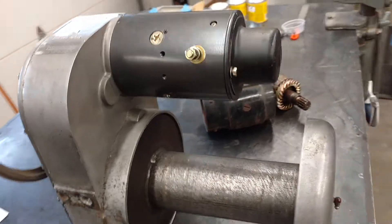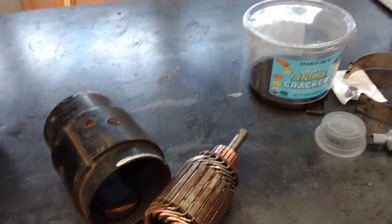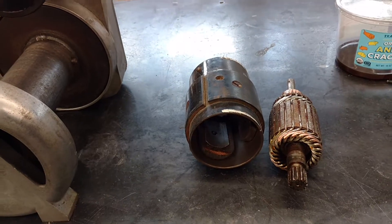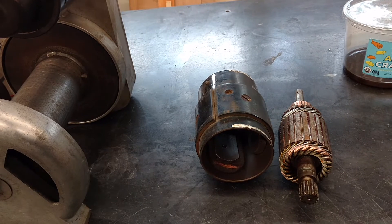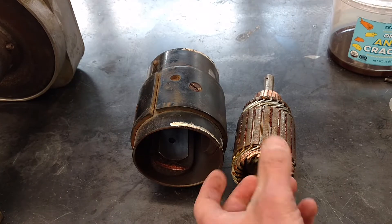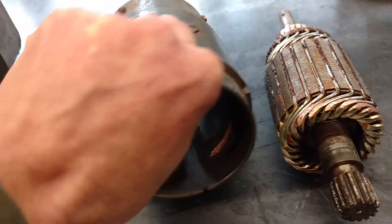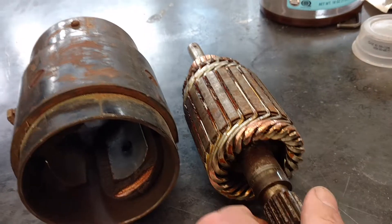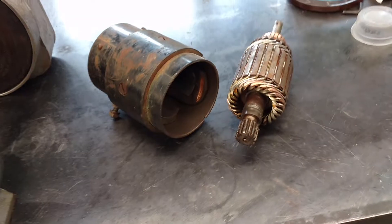Nice thing about it is it's only a couple hundred bucks — maybe just under — so it's better than paying 350 or whatever for a motor that you might not know will fit. Another thing about motors: here's the old one. You can't run these things backwards, it's just not good. If you're trying to free-spool cable or something, you've got to make sure the motor is not engaged. What happens if it is engaged is these windings unwind and impact the inside. I actually pounded them back down thinking I might try to repair it, but I just went the new motor route. That'll ruin your motor pretty quick — don't do it.